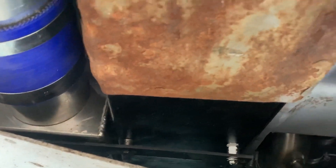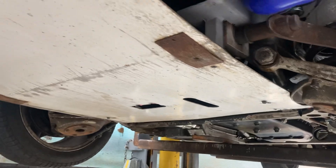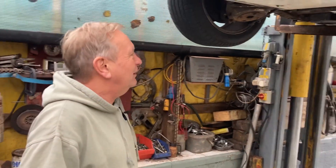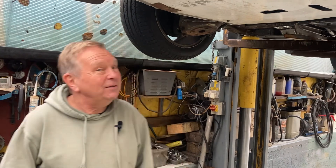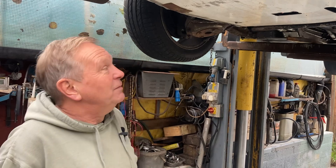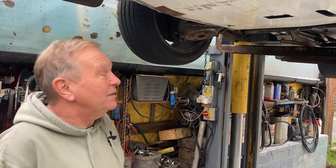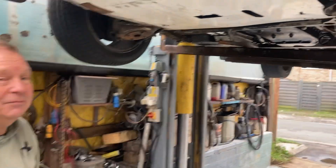There's the intercooler pipe, and that's a fair old radiator — yes, I made that. There's a bit of a story: I made that rad originally years ago, just an ordinary core with brass sheet end tanks. Then I decided to get an aluminium rad to be trendy — but in my experience the aluminium rad didn't cool as well. A guy in drag racing found exactly the same thing — his friend had the same build, put an alley rad in and it was warming up too much. I spent fair money on that alloy rad, was disappointed, put the brass one back in, and fixed it.